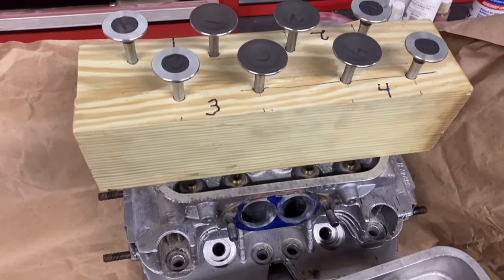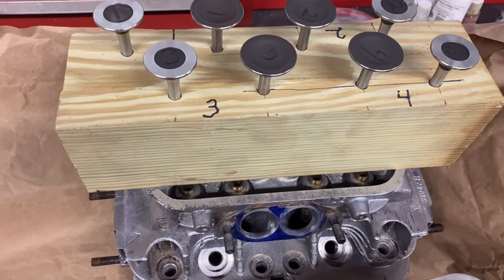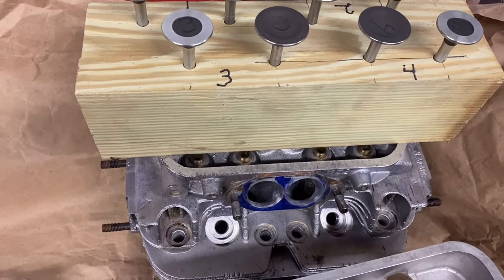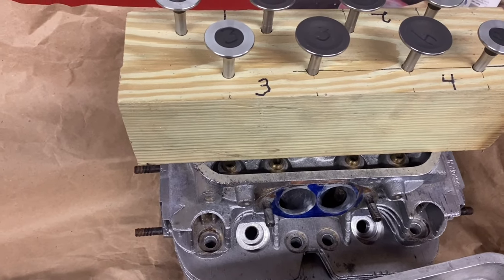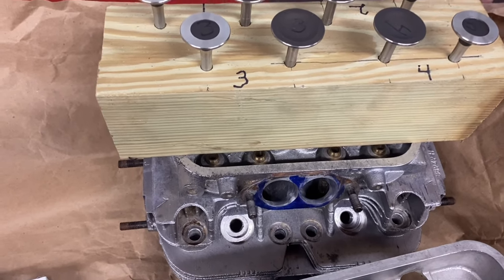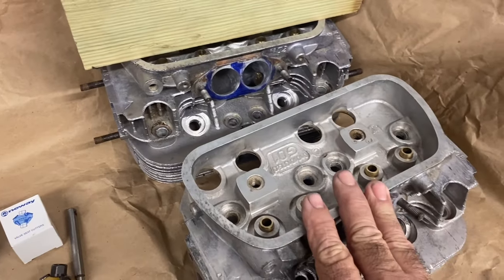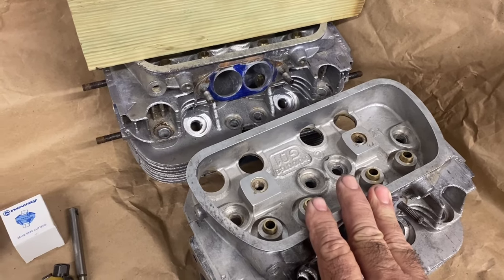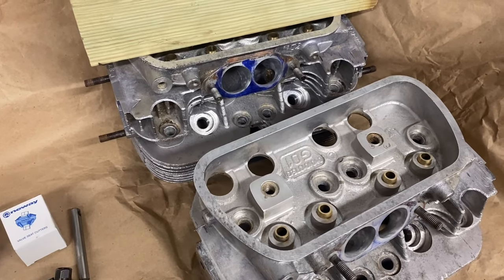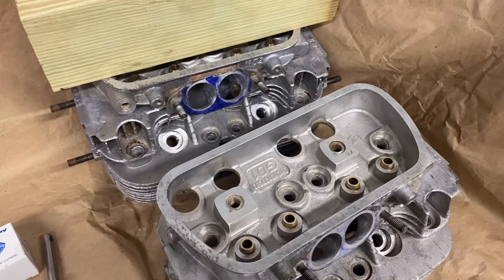You can face valves on a lathe with a single point carbide tip cutter, or if you have a tool post grinder you can grind them. If you don't want to do either of those and you have old valves, you could take them to a machine shop to have them resurfaced. Or in some cases if you just need one or two — for this motor, for these heads — the valves brand new are less than $10 a piece. So it's cost effective to buy new valves and do your own valve seats, and you've got a nice three angle valve job.